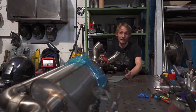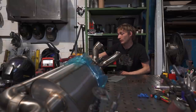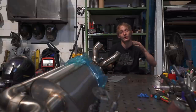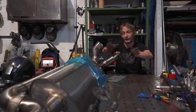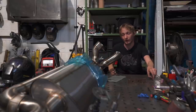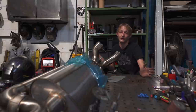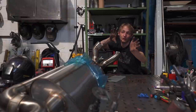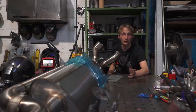You'll have seen that we've got the Offender back in the workshop for a couple of upgrades. One of those is the exhaust system — we've decided to slim it down. Previously we had two silencer boxes and two separate exhaust systems that collected once before the silencers and then split into two. That's a lot of tubing underneath a truck, and it's all very hot, with it still being four-wheel drive. We've got a lot of shafts, pipes, fuel lines, and filters — not a lot of room. By using this new box and design, we're keeping all the tubes on one side of the chassis, leaving the other side clear.